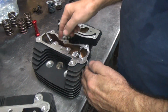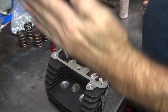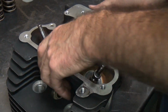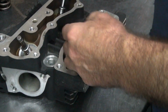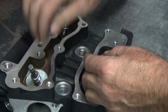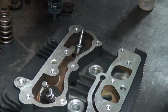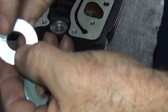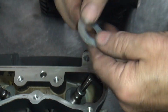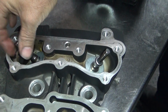The thing is, if you keep beating on it, it goes to a certain point, and then it gets taller. Right. Because it starts to cut the seal off, it comes up, and the break cuts it in half. Destroys it. Okay, so we got one shim, one lower collar, one shim, one lower collar. Now on the shims, the serrations go down because that lets oil get in there to help cool it so it doesn't get so hot. At least that's the theory. In the real world, it's hot.